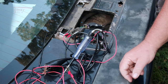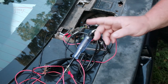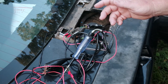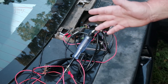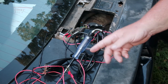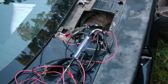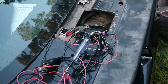Quick primer on how this should work: if I turn the key to the run position, this light should light up briefly. What that does is apply power to the electric fuel pump, pressurizing the system so that when you go to actually start the car, the fuel injectors have fuel pressure on them and the car starts. It only does that for a moment — otherwise it would burn up the motor if you just left it in run. When it's cranking, we should see it lit all the time. So you're looking for it to light up briefly on key-on, then stay lit the entire time while cranking.